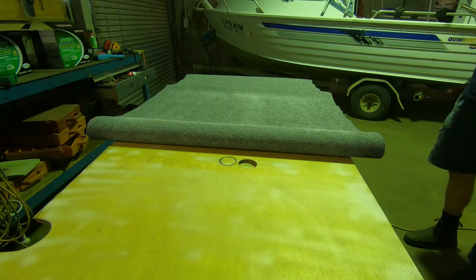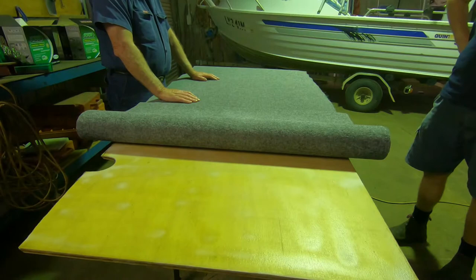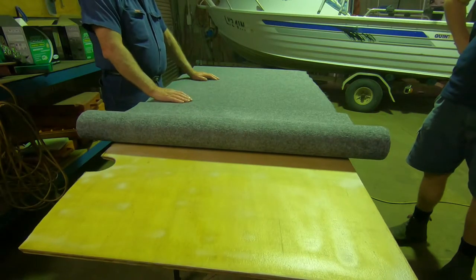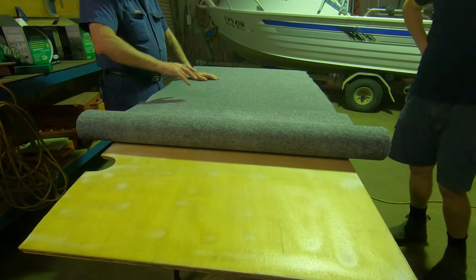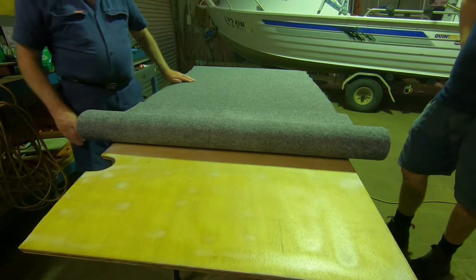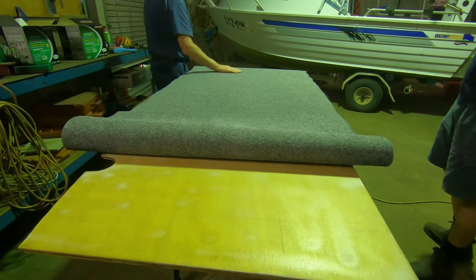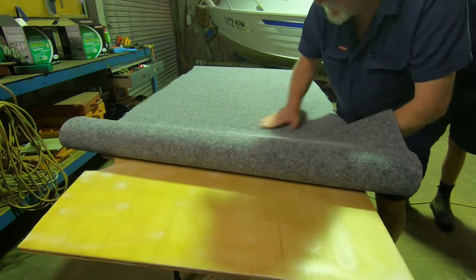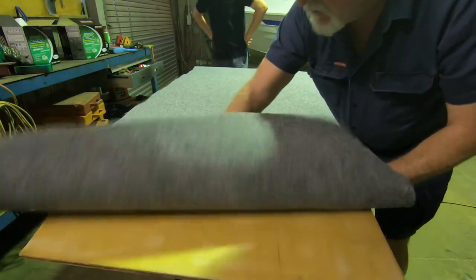I'll just slowly work up. Oh, that with the resin on that, that shouldn't rot for a long, long time. Because when you hose the boat out, and you've got all that fresh water getting into the timber, it delaminates the glue, but also causes dry rot in the timber. If you hose that out with salt water, it wouldn't rot. You don't get the dry rot, see? Yeah, but dry rot's from fresh water. Well, some boats, that's all they do to clean their boats because they're on the water. Oh, okay. If you're on a mooring, you've got no fresh water unless you've got fresh water tanks.